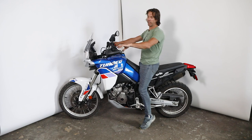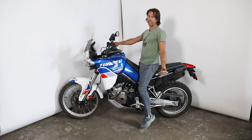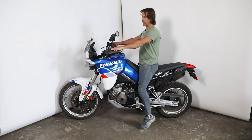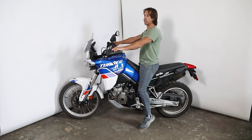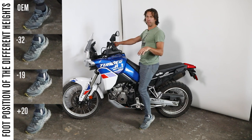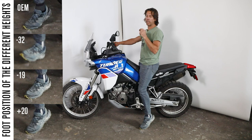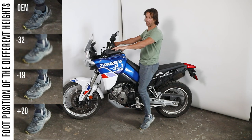Even if you're not an aggressive rider, I'd really encourage you to try this — it only takes four minutes to unload the rear wheel and do the pivot change. Here I am in the lowest cradle of the seat at the tallest height, 20 millimeters over OEM. We're going to skip the second height position that goes above OEM, since it only takes you 6 millimeters above the OEM position and visually you're not really going to see that difference.